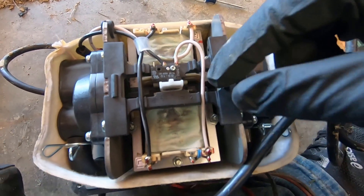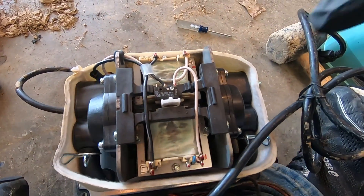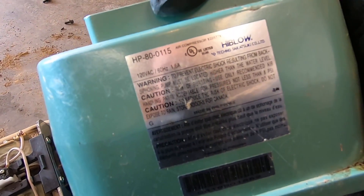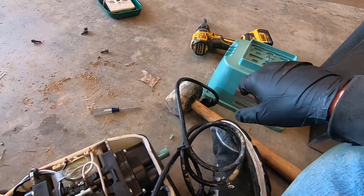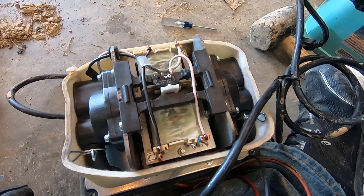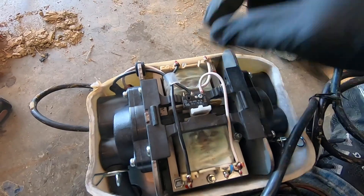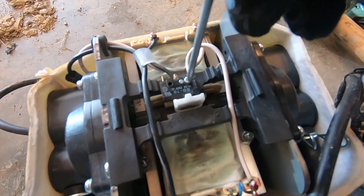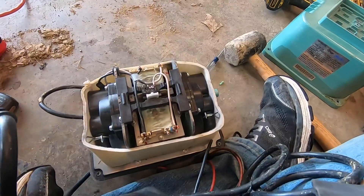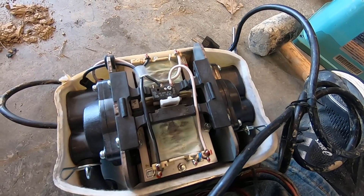In my case I can buy myself a little bit of time. I'm going to order the switch assembly - it's about thirty-seven dollars online. It comes with the whole black plastic piece and two wires and it's called the safety switch. I have the Hi-Blow HP80 115-volt model - they do make different sizes with slightly different parts, so this is just a general overview. As a temporary fix, I loosened the screw a little bit, pulled the switch this way, and tightened it back down - and now when I plug it in it works, which should get me by long enough to order the part and replace it.